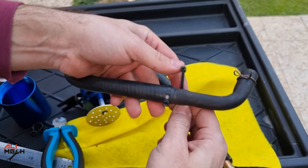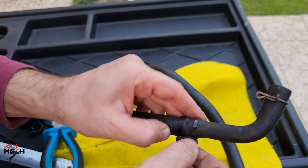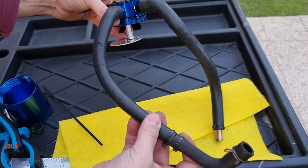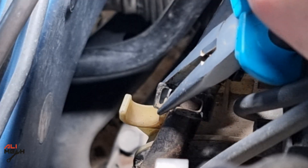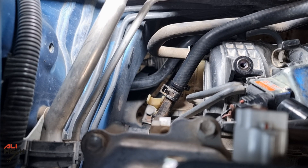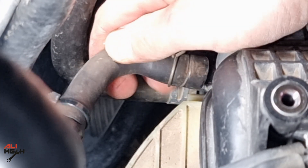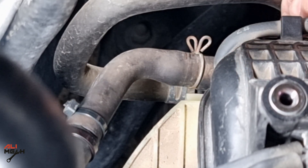To give you an idea of where I cut the hose — I cut it after two and a half inches. I also had to use zip ties even though it was a tight fit. This one goes on the engine and this one goes on the other hose that came from the PCV valve. For this one I used a hose clamp instead of a zip tie because I didn't have that much room to work. The other hose goes on the intake manifold of the engine.